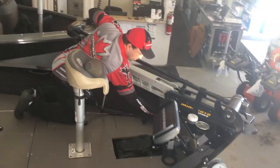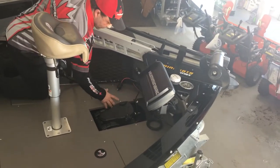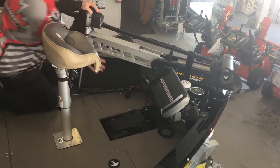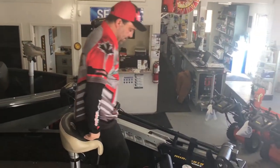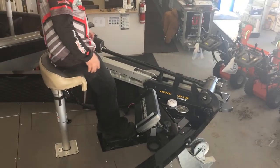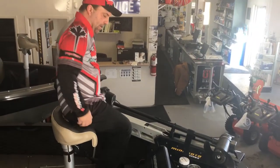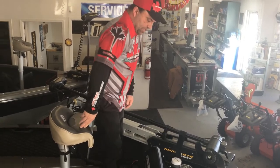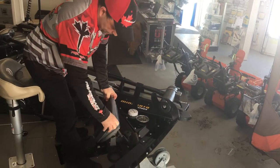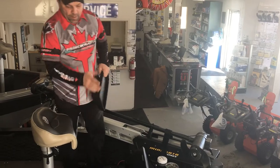Nice spot for your leg poles so it's not bouncing all over the place inside. The recessed floor in here with the foot pedal is also a must. What's really nice about that is when you're sitting on your chair right here, you can sit down and actually have your weight on something where you're more stable in rough water and you can use your foot pedal up and down — your leg's not up here hurting your back all the time. Another thing I also introduced to this was a really good RAM mount, nice and solid.